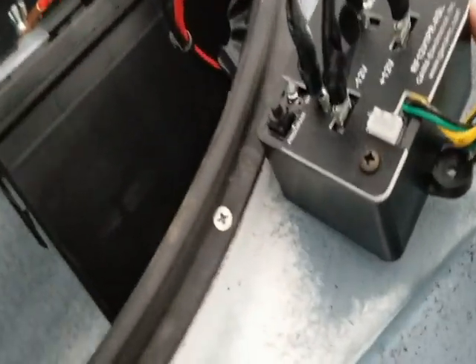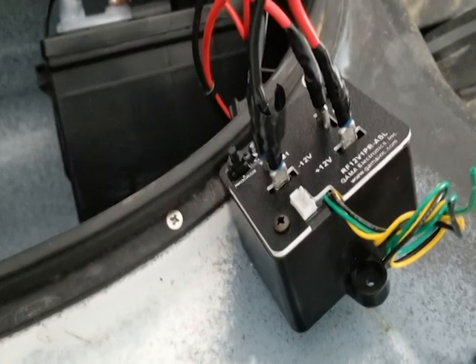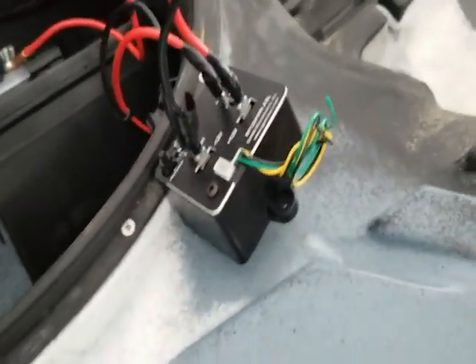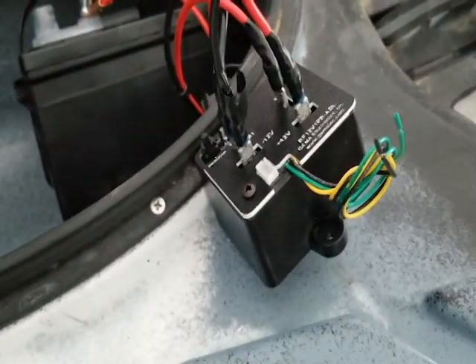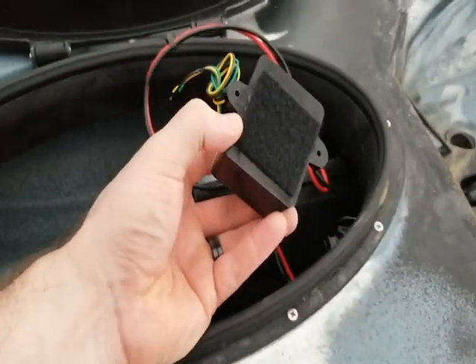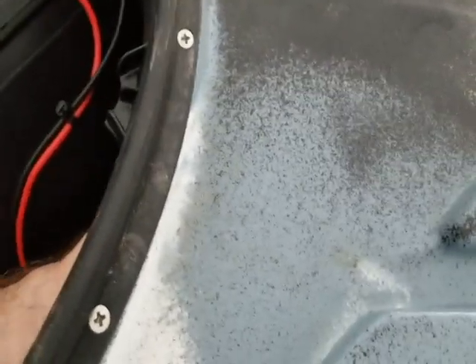This is just your standard marine battery — a 625 deep cycle marine battery, nothing special, 60 to 70 bucks at Walmart. What I want to talk about is this RF switch. The purpose of this is so that I can turn on and off my trolling motor from inside the seat — I don't have any handle to turn on and off. Instead of just having an on/off switch, I need to go in reverse too, so I picked up this reverse polarity switch. What it does is reverse the pull of power, so I can flip the circuit to basically tell the motor it needs to go in reverse. I just put a little piece of Velcro on the bottom here and it goes right inside this flat spot, just Velcro's on there — I have no issues with it coming off. It sits right inside the hull of the kayak, right in the front giant front hatch.